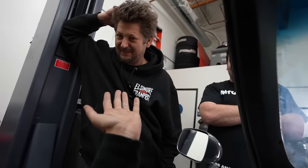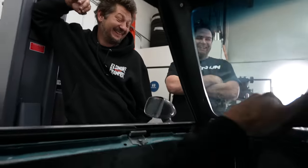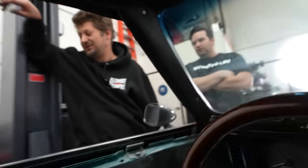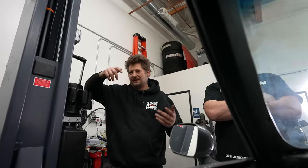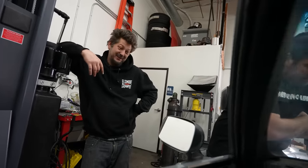I would've jumped out — it would've just added to Sandy's fear of riding passenger. We're dumb, not stupid, okay? We're into cars, we're dumb, we already know this. What savings account? I'm sitting in it. Drugs would've been cheaper. There goes first drive. We gotta figure out why the brakes aren't working. It almost feels like we have a bad booster — you step on it, it's almost like it's hitting a wall, there's a hard stop. It's not going all the way down and it's not stopping the wheel. At idle you'd think it would've stalled the motor. Somebody bought the humongo brakes, just trying to make you feel comfortable in the passenger seat.